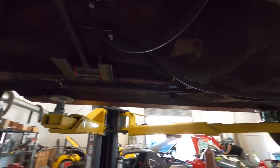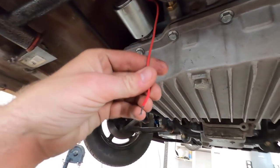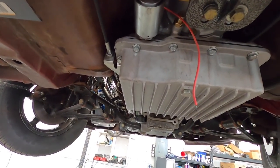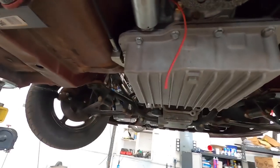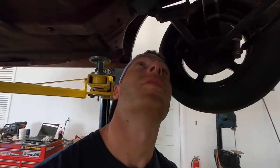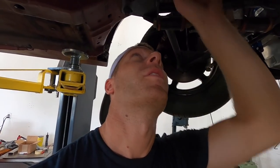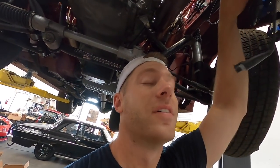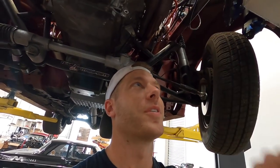Ty just made a great point that I'm going to know this car inside and out. I lifted the car up to install the trans overflow from Motion Raceworks, and that would explain why the trans brake isn't working — because it's not hooked up. Just learning little things about this car and getting it figured out. I almost had the fuel pumps wired up and the fuse blew because I don't have any relays on them, so now I need to get some relays.